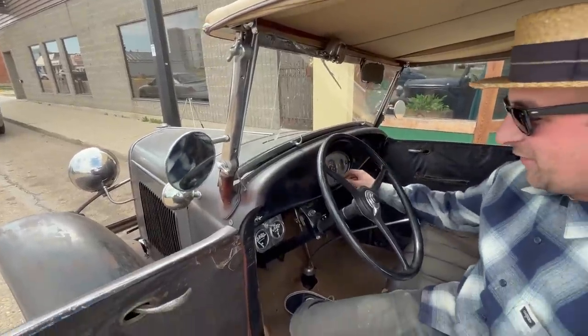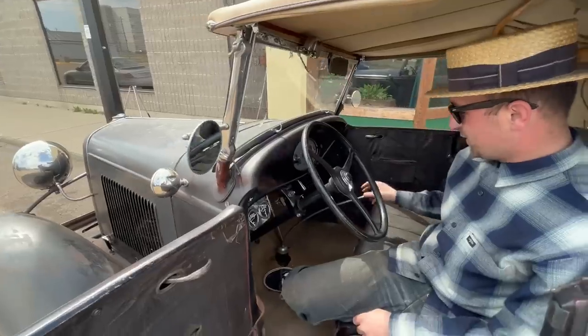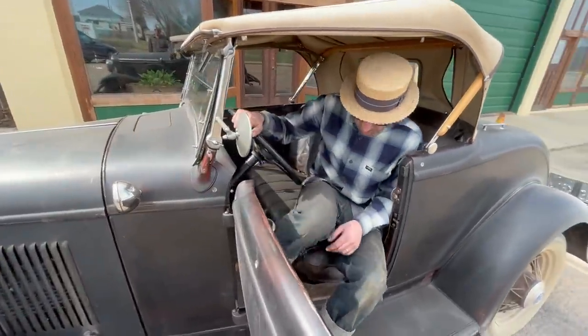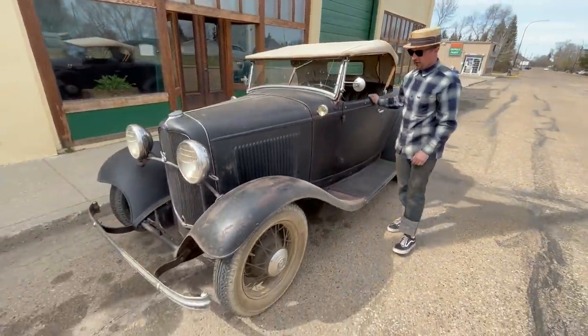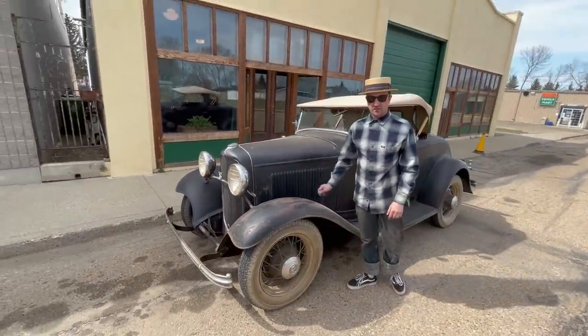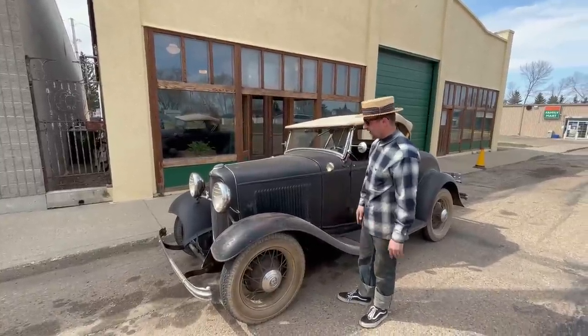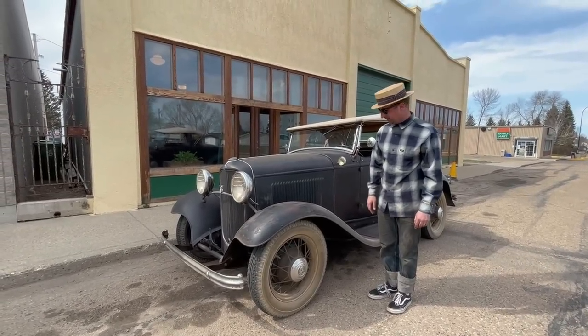Yeah, every aspect of the car as it was works. Cowl lights work, horn works, e-brake works. It's a brand new engine that probably only has about 250 or 300 miles on it, so we're going to drive it a bit more, and then we're going to reset the valves because they're, like I said, adjustable lifters, so that's one thing we have to do yet. Wait for our new tires, but overall, the car is ready for enjoyment for many, many years.